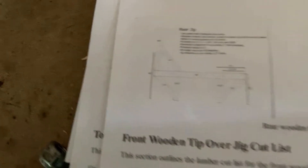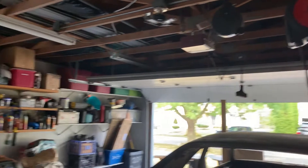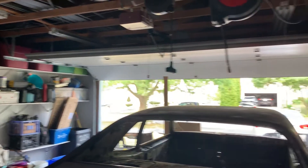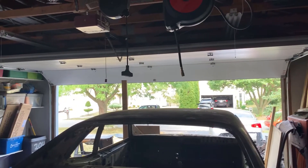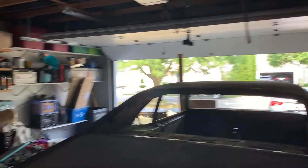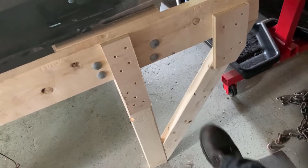There are the dimensions and everything for the rear jig, and almost everything is right. It's kind of hard to see as it tries to focus, but that's supposed to be 80 inches wide. I don't have the lights on because it's so damn hot in the garage, but I went seven feet. The reason for that is I don't have a very tall ceiling — it's about seven feet, seven-four, seven-three and a half, something like that to the garage door. So I'll have to flip the car with the garage door closed, but it'll open once it's sitting upright.